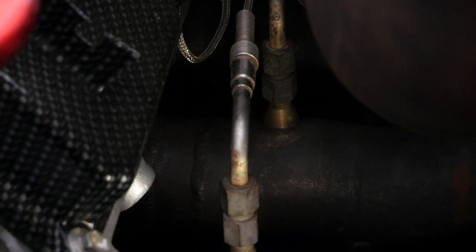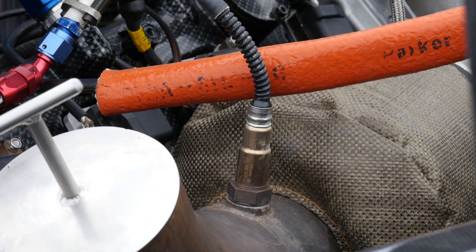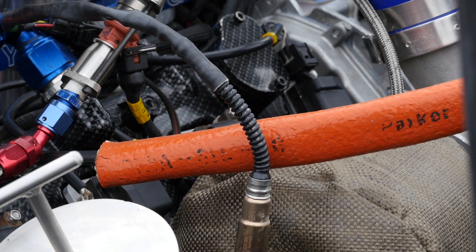One of the key inputs we're using to help tune this engine is the individual cylinder exhaust gas temperature sensors. You can see these sensors fitted to the header tube for each cylinder — they measure the temperature of the exhaust gases coming out of each cylinder, helping us to equalise the fuel delivery to each cylinder. This data is also used in conjunction with the Bosch wideband lambda sensor fitted to the outlet of each turbocharger, letting us see the air-fuel ratio. With the combination of the wideband sensor and the EGT sensors, we can make sure the engine is running perfectly.